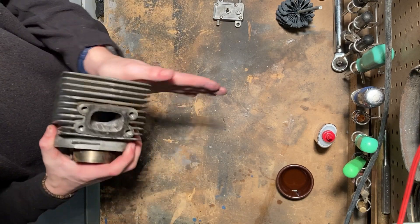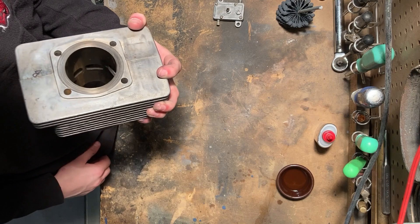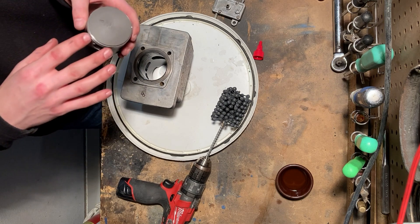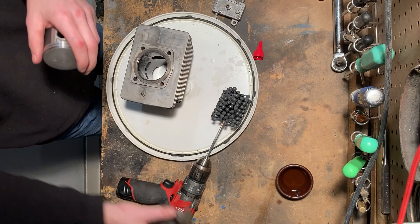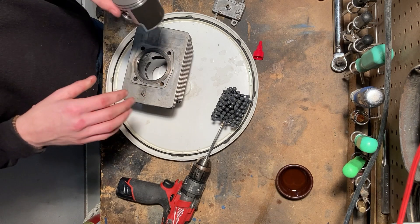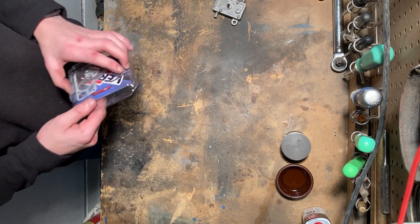While it sets, we're going to use a ball hone to smooth out some minor scoring in the cylinder. This is the rear cylinder — I imagine that in the application this engine came from, it was not getting adequate cooling, because the back cylinders are notorious for having cooling issues. I'm back with the new piston and it is Teflon coated — that black coating helps prevent huge heat absorption into the piston, which can cause cracks. That's what happens when you overheat a two-stroke, but this will also help with wear on the cylinder. I've got this to test the fit in the cylinder; I do not have the rings on, I'm just checking for a snug fit.